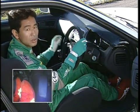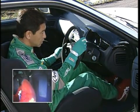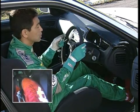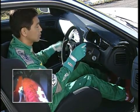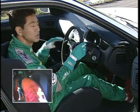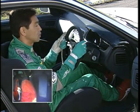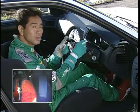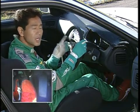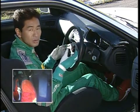Here, you're a little overspeeding. If you brake through the corner, you'll end up with understeer. So first brake and then turn, heel and toe and steer in towards the clipping point. You'll be overspeeding here as well. Then you shift down to second gear while leaving your foot on the brake. Let's say you're running around 5,500 revs when you shift down to second gear. Release the clutch like you're running around 5,400 revs, but don't let the gears lock. It's similar to shift lock drifting, but you don't lock the rear tires with braking drift.